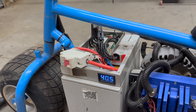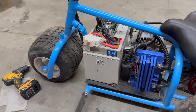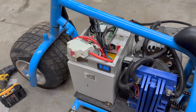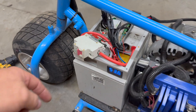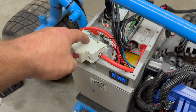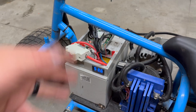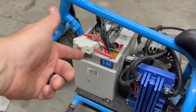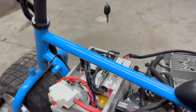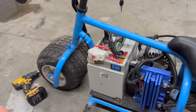It's been about 24 hours since the last clip. I had a lot to do today and I thought I was going to get out here sooner but just couldn't make it. We need to put the contactor back in, take the charger out, and we should be able to test it. We're reading 53.6 volts and it's looking good — the trick worked.